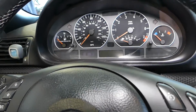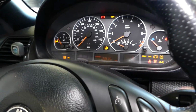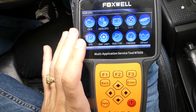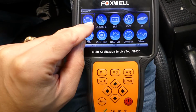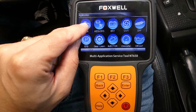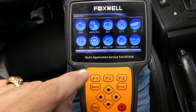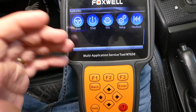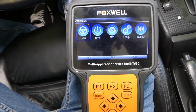Next guys, we have to turn our ignition on. You do that to the second position when the lights are on. Okay, like that, but do not start the car. This is the computer now guys, and you can do so many things, not just steering angle sensor with that thing. You can read and delete codes from the engine computer, ABS computer, traction control and brake computer, register batteries. Okay, you can see some of the functions I'm going to show you here, so you have an idea. Check it out guys. You can see where we bought ours from in the description of the video below.